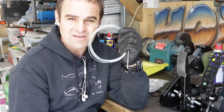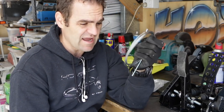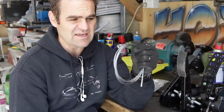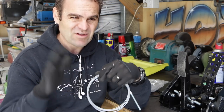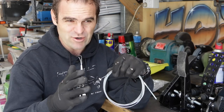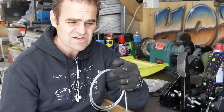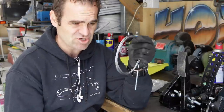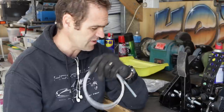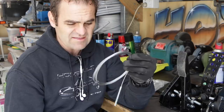It was brought up that potentially this cable is probably a little bit thin, and I will look into getting a thicker cable. I think this will work for now, but it's not a good long-term solution, because clutch cables are generally a bit heavier duty. Throttle cables don't have a lot of pressure on them, whereas the clutch is obviously much harder to press, particularly as this is an unassisted clutch. I'll use this for now, but it definitely has the potential to stretch and not work properly. So let's start looking at what I need to do to get this fitted to the car.